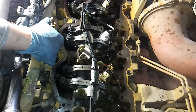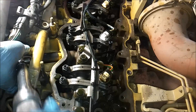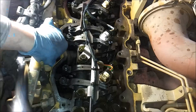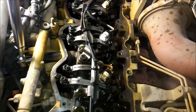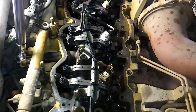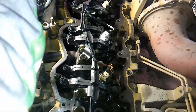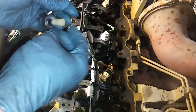We're just going to run it down and then torque it. I've done it before where I've done multiple injectors and removed the common rail - that makes all these quill tube setups a lot easier to pull, but then you have to change every line you remove. All these fuel lines on the common rail setup - the one coming from the high pressure pump and all the injector ones - have to be replaced if they're removed. So just remember that, and you never crack these lines for any reason. If you think there's air in the system, do not ever crack a common rail line - and not only that, you have to replace it if you ever loosen it.